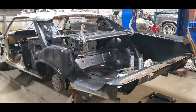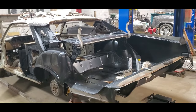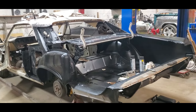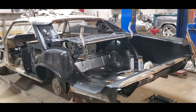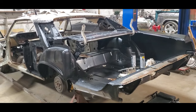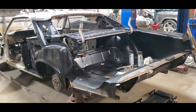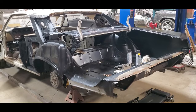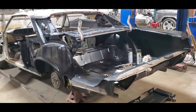What I'm going to do now is go ahead and get this other quarter panel on the car, get the rest of the parts back on, clamped, clecoed, put the trunk lid on it, get it gapped properly, and make sure everything is exactly where I want it. Then once I'm happy with that, I can start welding. Probably in the next episode we'll see the quarter panels on the car. I might do a quick video once the tail panel's out to show you some things on the inside that you need to make sure also get welded — another area I see people forget.